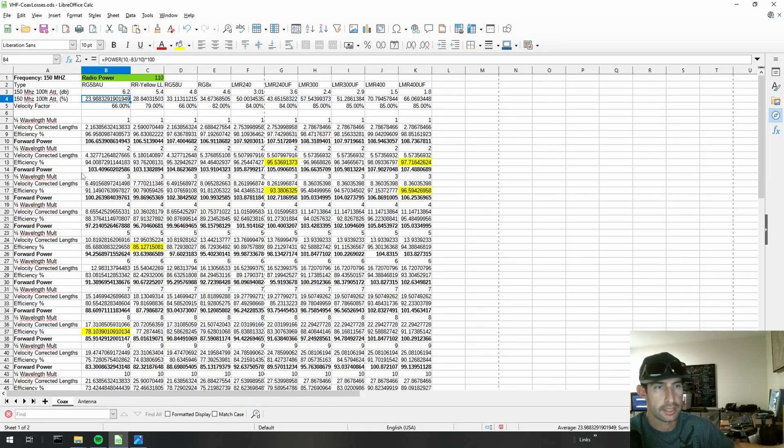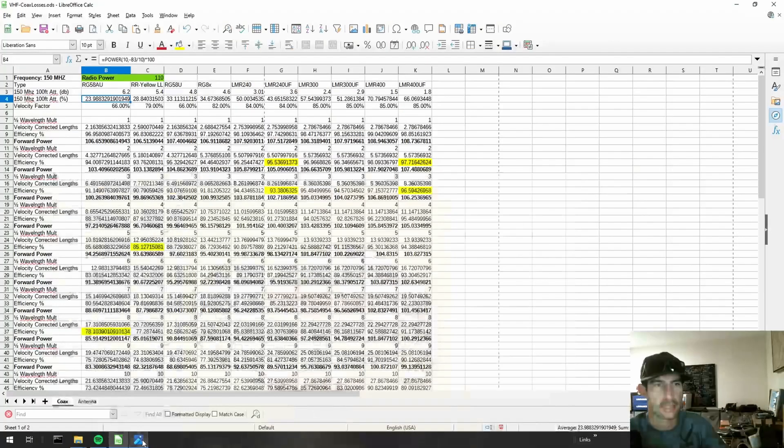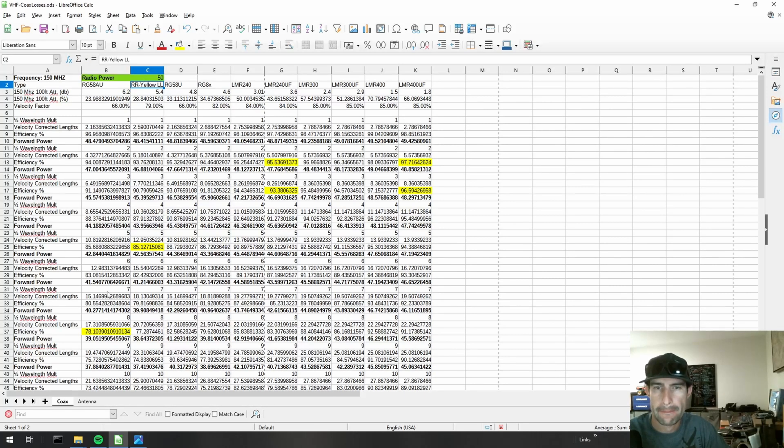Luckily in the off-road industry we're not running 100 feet of cable — we're going 17 feet or less, shorter the better. These pre-assembled kits that come ready to install — you drill a few holes, route the cable, plug in the radio — and you think you're off to the races. But that's not true. If you shorten to just 17 feet (what the typical kit is) with a 50-watt radio, and your antenna is a half-wave with a perfect tune, you're only putting out 39 watts.